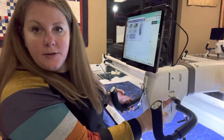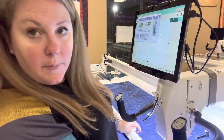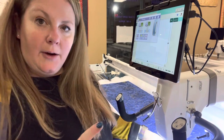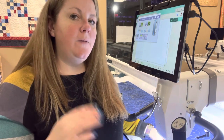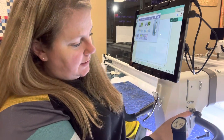After it's through the discs, there's a tiny little check spring right here. Your thread has to go on top of that spring — it's going to bounce up and down as you pull on the thread. That's how your thread break sensor works. If you're getting false thread break sensor alarms — it's telling you that your thread is broken when it's not — it's usually because the thread isn't on top of that little spring. The spring passes by this little silver cylinder on the side, and that's your thread break sensor. Every time it takes a stitch, that spring passes by there and that's how your machine knows you have thread. Sometimes you'll see false thread break sensors when the thread either isn't all the way in that disc or it's not on top of that little spring.